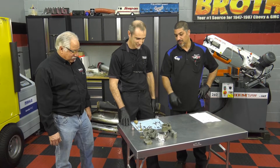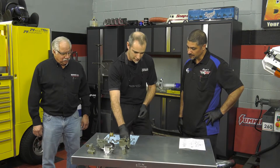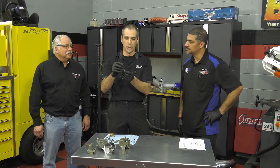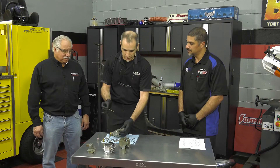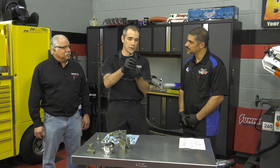This is called a vacuum piston or power piston. It hooks this little lever right here — there's a pin that's supposed to hook there, and we have another one to replace it. When it's in the carburetor, it fits in this hole right here. When the engine is running, it's controlled by vacuum. As the vacuum works, it pulls this valve down into the jet, which actually restricts the fuel by blocking off the hole. So when vacuum is on, it pulls it down, restricts the fuel, blocks it off, and leans it out so it runs better.